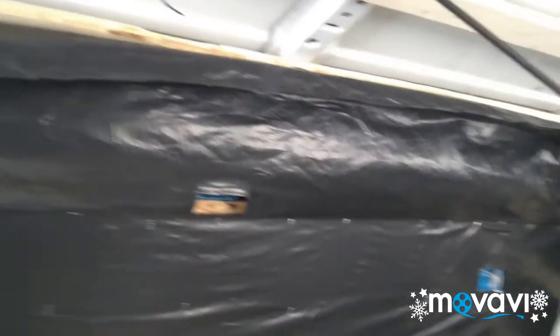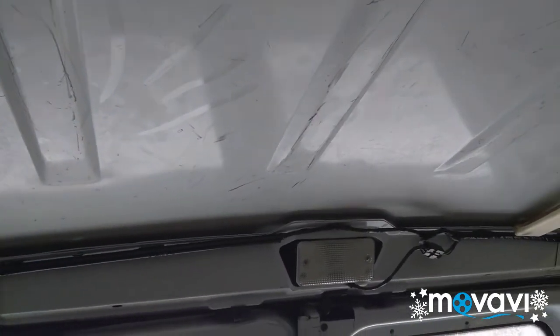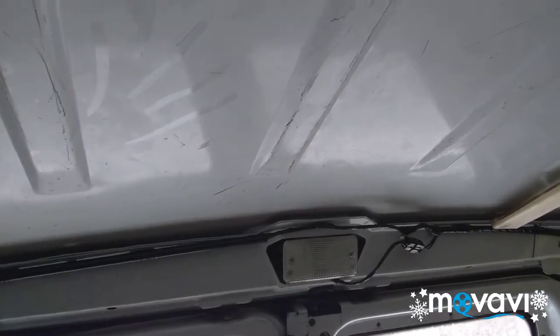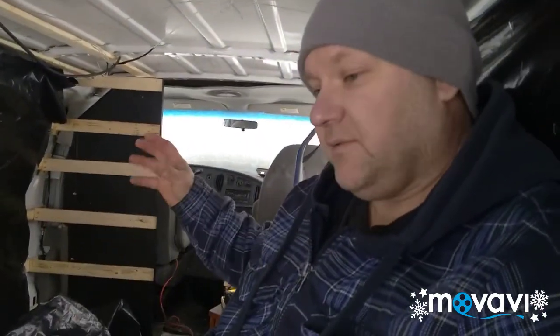What I'm doing this plastic for — you can see that when you breathe and there's something moist in here, you get condensation. What I'm trying to do is create a vapor barrier, which will help stop that. I'm not insulating it because I'm not going to live in here full-time. If it's winter and it's cold, we have heat while we're driving, and we'll have a small 12-volt heater we can plug into those accessory plugs, because we're going to have a marine battery down here that will run all night if we need it.